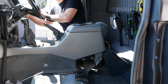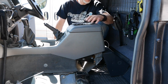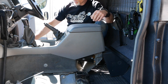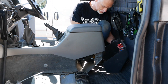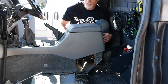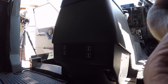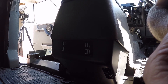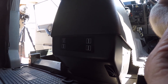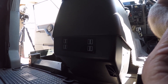It's working — it's charging my phone! Cool. So that's on an ignition live, so it's only on when the engine's running. I'll put some tape around those just to keep them in place. That's it, we're done — four screws and put the seats back in. Just a little look at what it looks like when it's in at the back. It's very difficult to film when you've got no rear doors or seats, but yeah, that's what you're going to end up with. And if you want to put another power supply in it, you can put a cigarette lighter plug in the middle — it's already designed to take one.